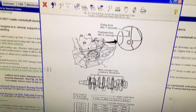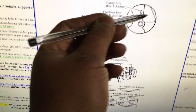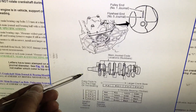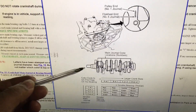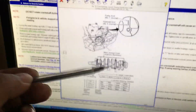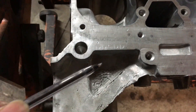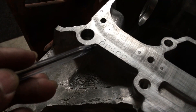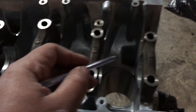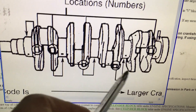Here's the marking — this is how you can tell what kind of main bearings you need. The marking is here on the block, and these are all the numbers. Since we're using a different crank and a different block, we have to go to Honda and buy the right main bearings using this chart. All those numbers from the block — it says D-D-C-D-D. We write that down and look at the diagram for the main journal.